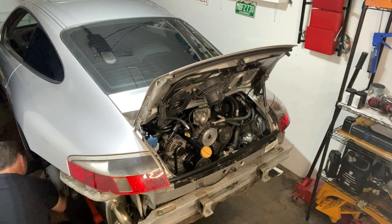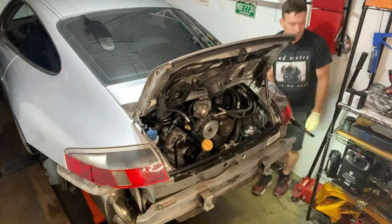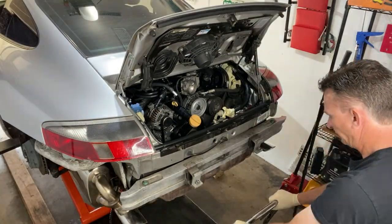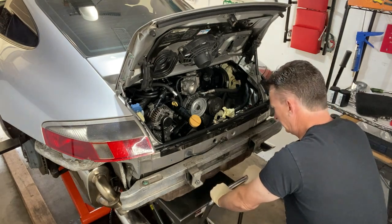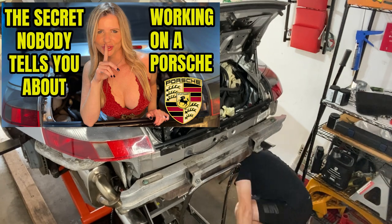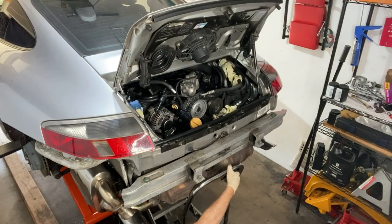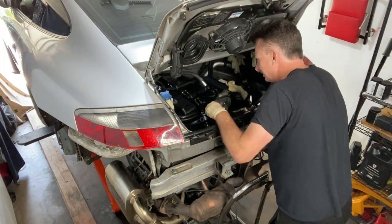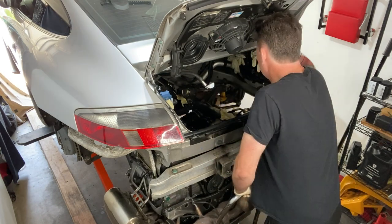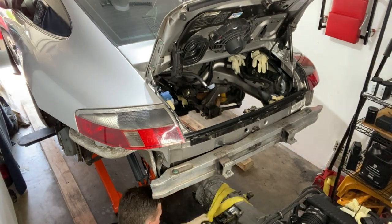Here we're removing a bunch of suspension items from underneath the car just like in episode 8 — the rear axle cross brace, lower subframe, stuff like that. Another significant difference from when I first disconnected the transmission in episode 9 is I didn't remove any of the transmission brackets or supports — I was able to save a bunch of time by just taking out the two bolts that go through the transmission mount itself. The first time I took the engine out of this car it took a very stressful three weeks. Mercifully, this time it took less than three hours. Thank crikey.